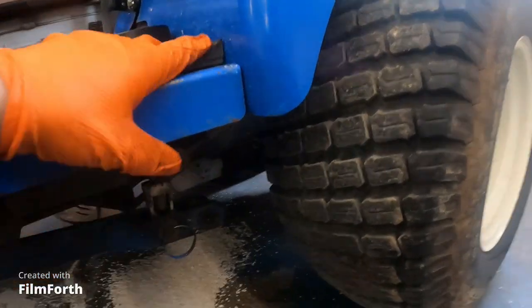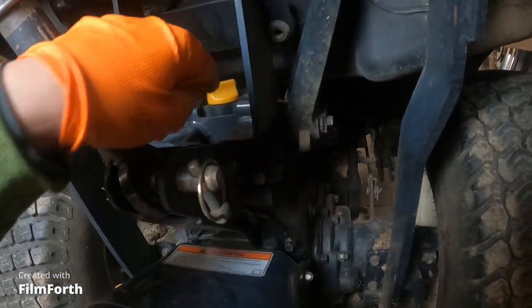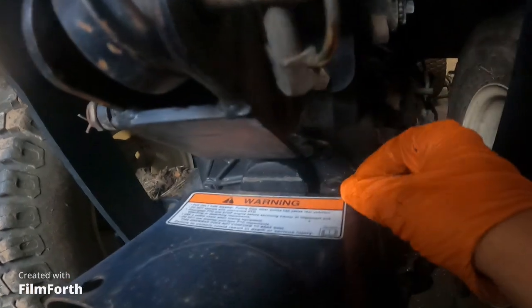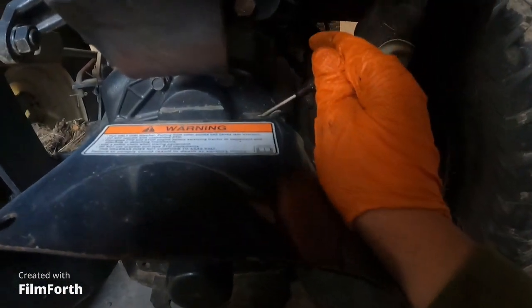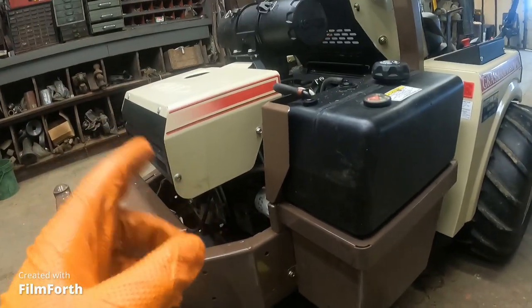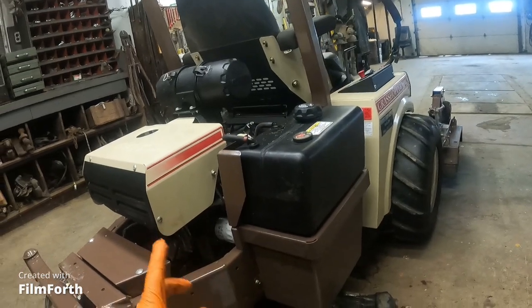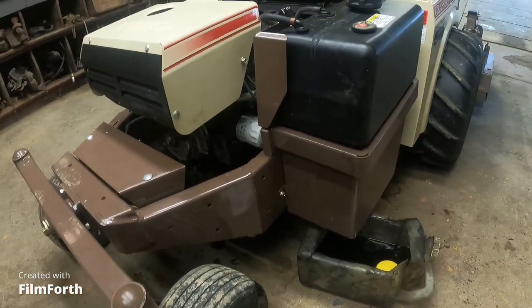That is done, changed. I'm going to put hydraulic oil in this thing now. And where you do that is right here. Put hydraulic oil in it there, and you check it. Right here with this little rubber plug. Okay, it's all empty because it drained it all out. But right there's where it goes, for those of you that are curious. So this mower is done, other than putting engine oil in, checking it, and starting it, checking it for leaks and stuff. It's been greased, and I'm going to go dispose of that. Got the new filter on. There's the old one. We're making headway.